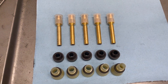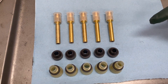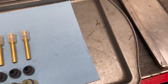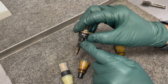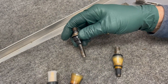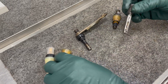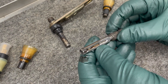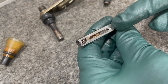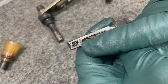How do you know if you should replace the injectors? They're not cheap, but currently not that expensive. The car we're dealing with is 43 years old, and these injectors are looking kind of old. I'm going to put a couple of the old ones on my tester and compare them with a new one so you can see the difference in both the release pressure and the spray pattern. It's also interesting to see what's inside one of these - they are not repairable and not serviceable. Fuel comes down through this long nozzle, and right there is a filter that can become a problem over time.